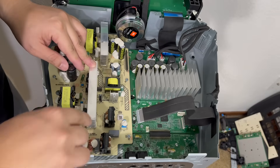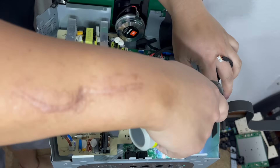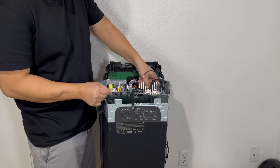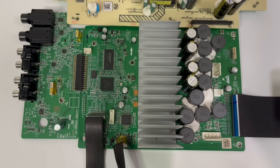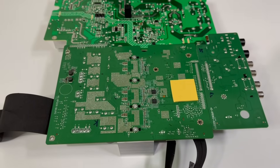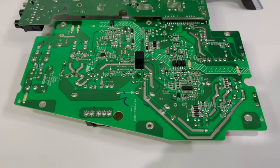Next, we will remove the motherboard and power board by taking off 13 screws, two ribbon cables, and four cables. Once done, both boards can be lifted as they are connected together. First, we have the motherboard — this component allows the speaker to function as a versatile device: a Bluetooth speaker, PA system, karaoke machine, and even a guitar amplifier. It allows for true wireless pairing to another Party Box 1000; however, it's worth noting that it's not compatible with the JBL Party app. Here is the power board that provides the speaker with up to 1,100 watts of power. Keep in mind that this speaker does not contain an internal battery like other Party Box models, so it will be required to be plugged in for operation.